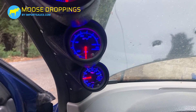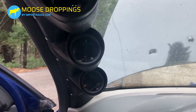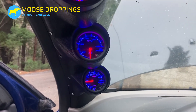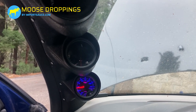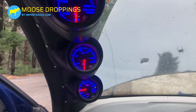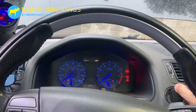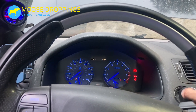Coil packs are unplugged. Press clutch — I forgot I have a stick. There's no pressure; it went all the way to the floor. Hopefully that is enough to clear the sensor. We're spinning everything, letting the oil pressure build up. I'm going to crank it a few more times, go look under the engine, make sure the coolant started burping, and then plug in the coil packs.